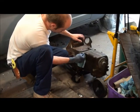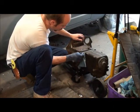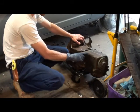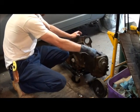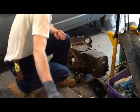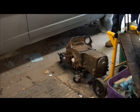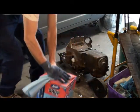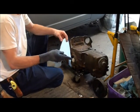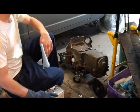I've already washed it, and I've lightened it a little bit. You guys are probably wondering how I lightened the differential transmission — well, I took the grinder and took off some of the casting marks. There's one on the top I took off, one right here, a couple on the sides. I probably took off a good two pounds of iron off this Cobra transaxle just by taking off all the casting marks.